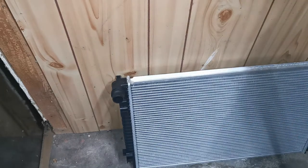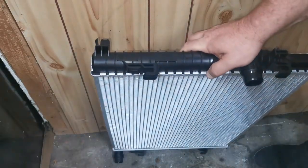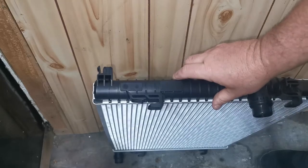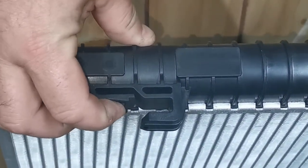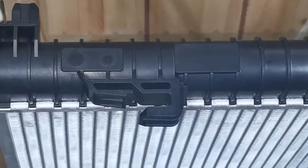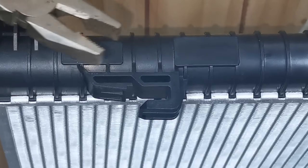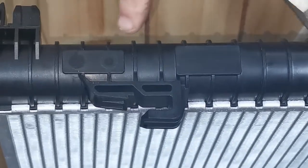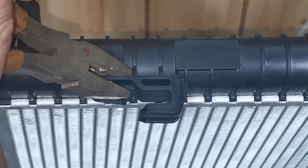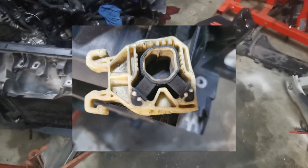You'll notice that when you start moving, you can actually move the fans a little fraction — they will jiggle a little bit. That clip actually folds in and it's very, very tough plastic. The easiest way I've found is to get a pair of pliers and get them into the corner of that little wedge there, push the plastic hard in and pull up at the same time on the fan on that side, and it'll click out. Make sure it stays up.